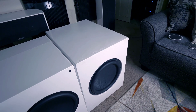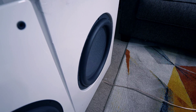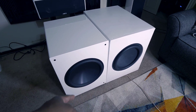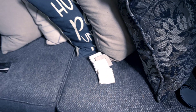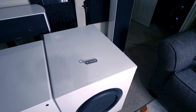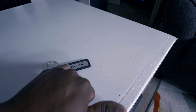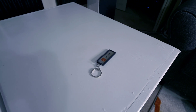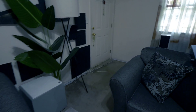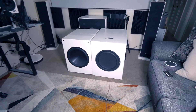Alright, 20 hertz at pretty decent volume — nothing crazy — but you can see just a little bit of excursion. It's moving a lot faster to me than it appears on camera due to frame rate. The beauty of dual opposed sealed subwoofers is that it does not vibrate. I don't have any feet on the subs — just some carpet sliders underneath. Because of the way they're built, the drivers cancel each other out so there are no vibrations going through the floor. You can push this with one finger — very slick. It doesn't vibrate whatsoever, and that is incredible. There's a lot of pressure in the room — a lot of bass — and that's just this subwoofer.